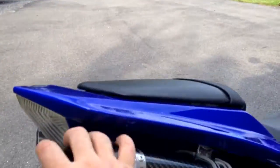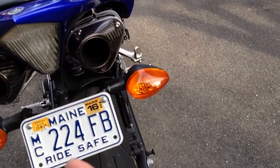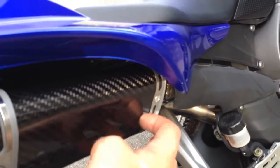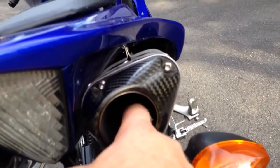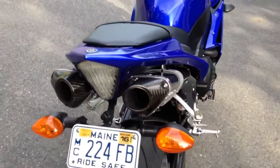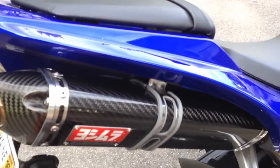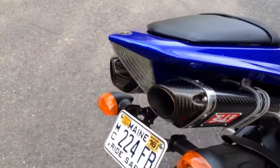Okay, so anyway, you take this end off first. Then, gently, I bunched up a rag and put it over the pipe, and I used a hammer. Like I said, all these rivets are out back here, so when this band's off, the rivets are out. Very gently with a hammer, because you do not want to bend the pipe in here. You tap it. You give it a lot of tapping, and after you start tapping it, you will see this end start backing out. As this end backs out, your packing starts sliding out, and you've got to work at it. It takes a little bit.